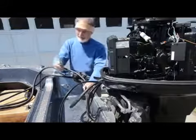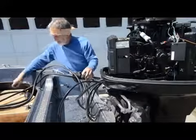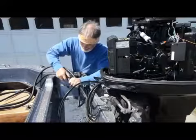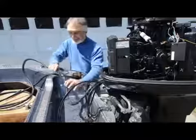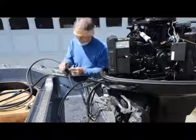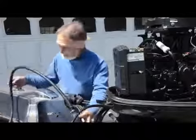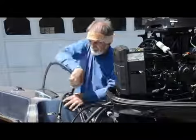Here's my razor knife. And here's my new primer ball that will stand up to ethanol. I put the attachments on it, got my primer ball attached. Now I'm going to take my fuel line and feed it right down through where the old fuel line went. Here's my fuel water separator with the gas lines from the gas tank and to the outboard installed. We're done.